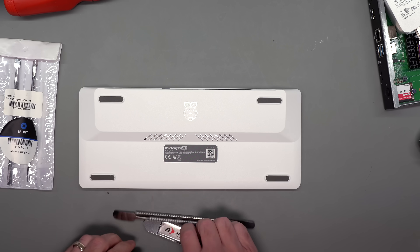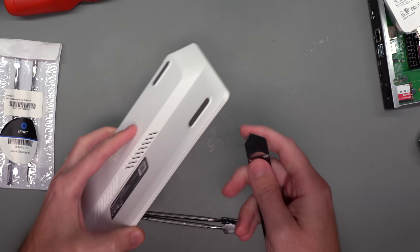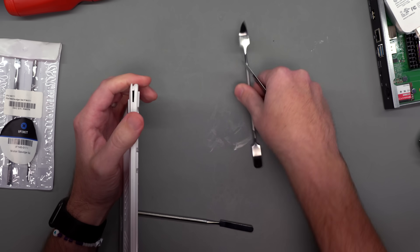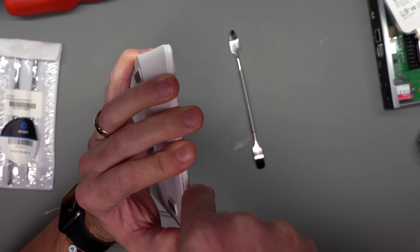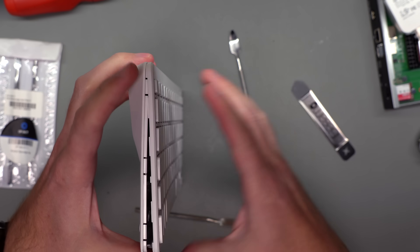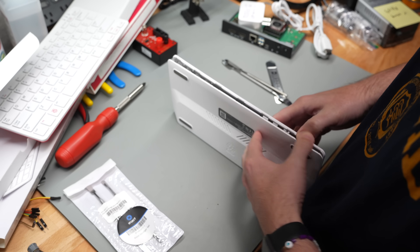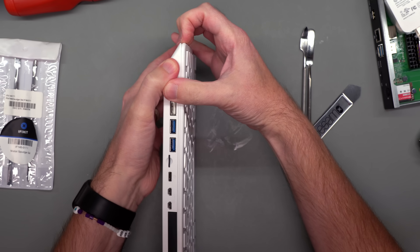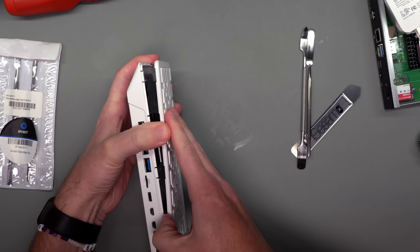This is not meant to be user serviceable — I opened it before, you can see some evidence of that. If I can pry up this corner clip, that's a good start. Now it's just a matter of popping all of these out. I'll try the spudger on the side first. Sorry about the lighting. Let's start working on this seam — you can probably do the rest by hand. My fingers are a little dry so I might end up with a cut, but they do pop out. It's not meant to be user serviceable, but it's not impossible — just kind of annoying. You probably want to do this more delicately than I am.